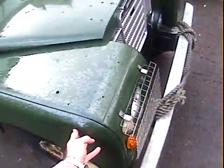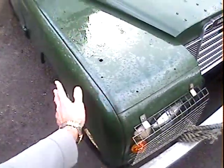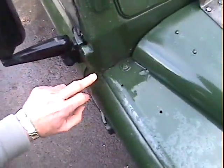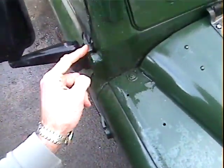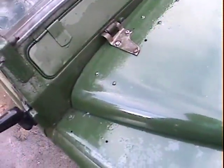There's a very slight depression just here in the usual place on the top of the offside front wing, just there. Around the scuttle area once again it looks pretty good actually. It's bubbling very slightly just here, perhaps had a little bit of work there in the past, but pretty good actually. Down on the A-post here — not bad at all.